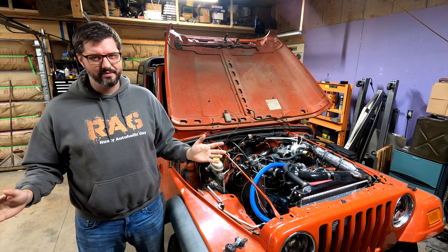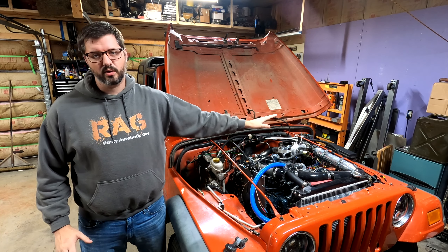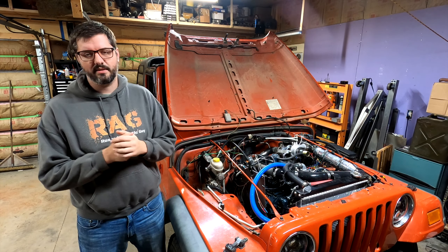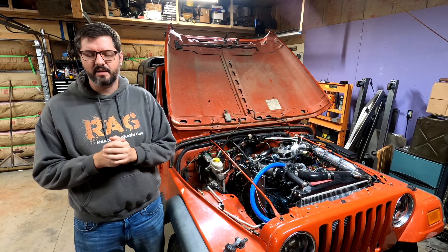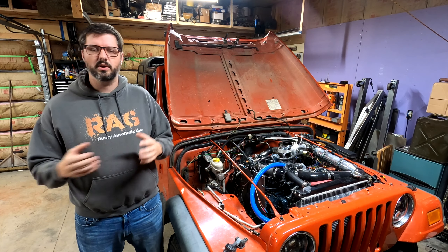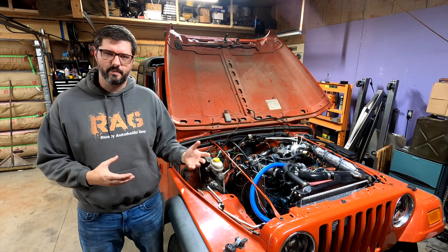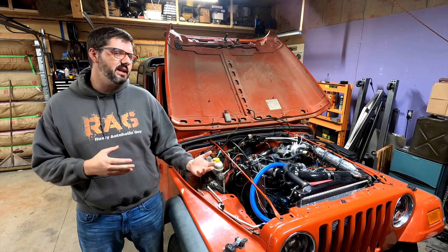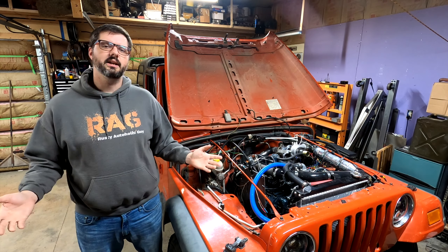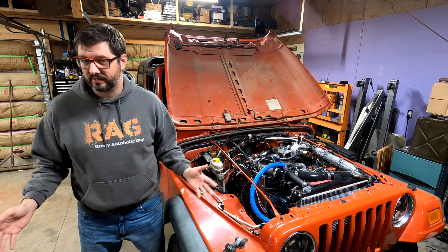Alright everyone, that's all I have for this video. I'm very impressed with how the bigger water-to-air intercooler performs. However, it's not efficient enough to drive this every day. Right now you absolutely have to keep your eyes on an EGT gauge, and I just don't want to drive it that way. I want to have enough headroom in the cooling capacity that I only really have to pay attention to the EGTs when I'm on a long climb. Next time we're going to try separating out the coolant loops and see what that does.